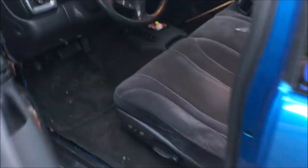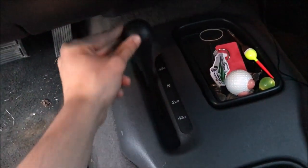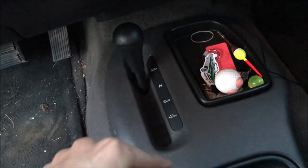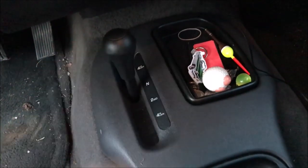Let's get to work. See how this shifter is really loose and just free-gliding? That's because the linkage going from the shifter to the transfer case fell out, so this is just a unit by itself right now. There's no light on my dash either, so I really don't know if I'm stuck in four-wheel drive or two-wheel drive, but we're gonna figure that out once we get that linkage installed.